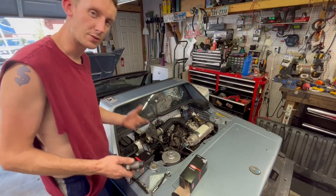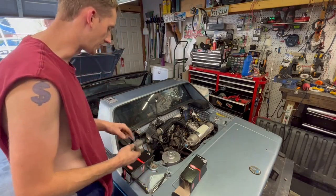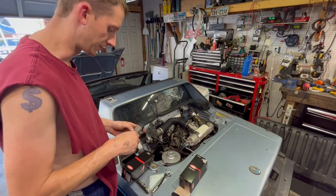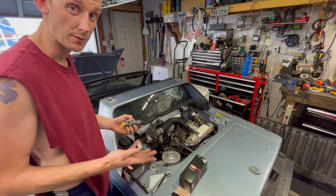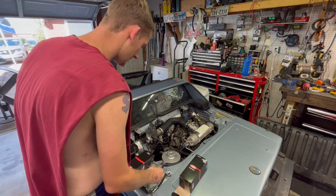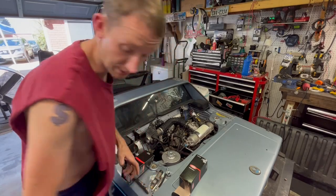It's gonna be tough to bring you in there. I'll do my best, but let's take this old one out. We'll install the new one, then we'll crack this bleeder and start putting some fluid in there. And hopefully it'll start gravity bleeding and get some of that air out of the system. Looks like a 13.